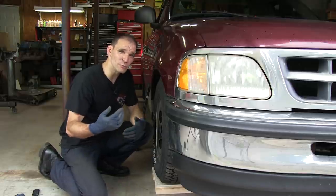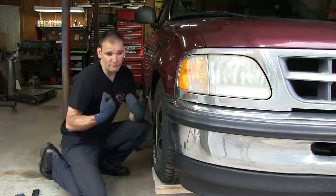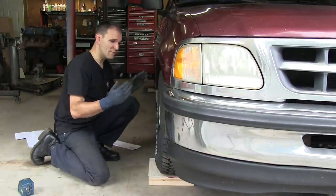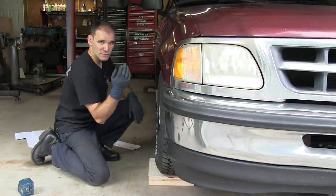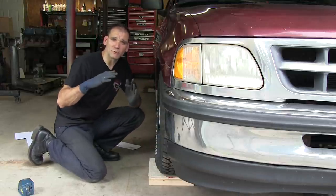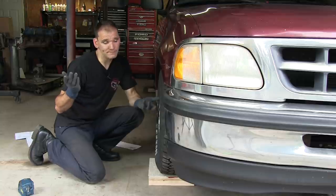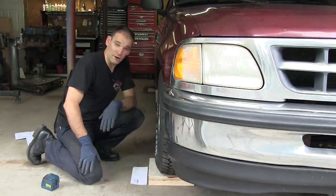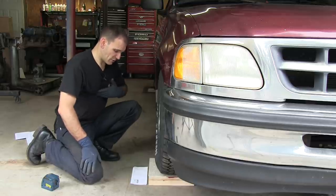It will give you back some road feel, which is something that I enjoy. I want that. But remember, the catch is that as you increase or decrease caster, you're affecting that camber measurement that we took. And if we get too much camber, it's not going to handle well. So we got to be careful. It's a balancing point. All right, well, let's try this. Let's see if we can actually get a good measurement out of it.